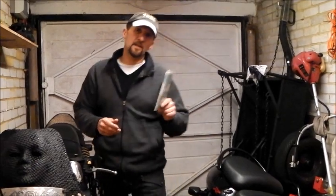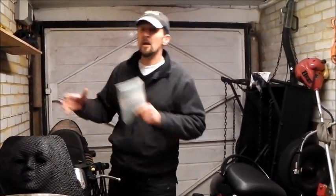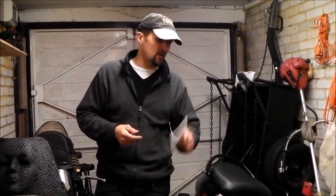On the Bandit, 36 to 38 psi in the back tyre when carrying a pillion — I run 42 in the back, which keeps the carcass shape correct. The Hayabusa back tyre pressure is 42 across the board, so you don't need to change it. Never go above 42 — it really isn't wise. The tyre becomes too hard, the rear contact patch becomes too narrow, you're losing footprint, and that's not a good thing. Respect the factory settings — they are good.